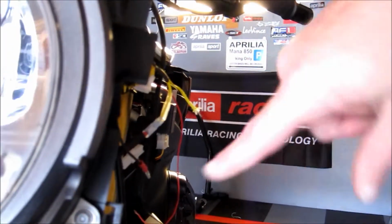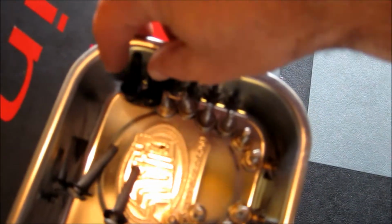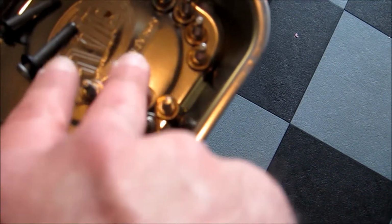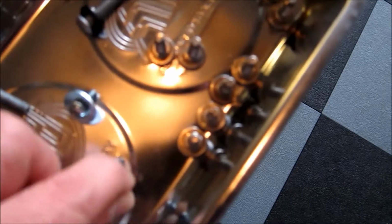And then it was an outward motion with the fairing, so pull it out towards us, because there are clips that you don't want to snap off. And so that's it. If we count it up, we have our 2 screws from our visor. We have the 6 screws from the dash. We have the 2 from the interior of the trunk liner. 2 from either side of the fairing. So that's those 4. These 2 right here from under the nose of the bike right there. And then these 2 are the 2 that I spoke about that came from the inside of the fairing right here.